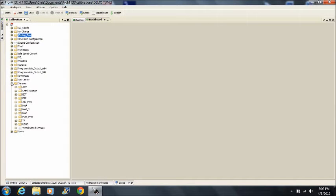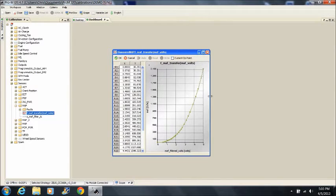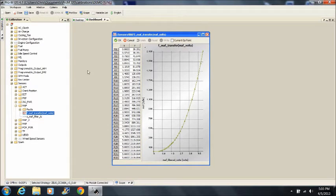Next, enter the meter's transfer function into the tune. Make sure the transfer function is accurate. If the meter is a Pro-M, use the transfer function sheet provided. If not, it'd be best to send it into Pro-M to have an accurate transfer function sheet generated on the flow bench. If using the meter in a blow-through configuration, the relevant ducting and meter should be sent to Pro-M for an accurate transfer function.